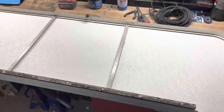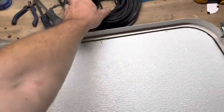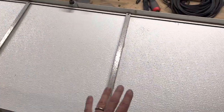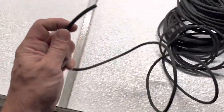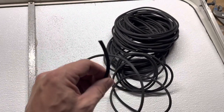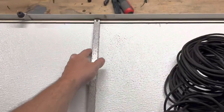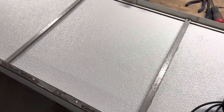Use a cut-off wheel tool to cut along that line — it cuts through like butter. Lay the new shower wall with the smooth side facing outside. Then put two new rivets on this side to tighten everything up, trying to get it centered left to right and up to down. Then take some screen door spline — that stuff you shove in to keep everything tight in window screens — and shove it in all the way around. I also put some adhesive caulking underneath the strut so it actually sticks to the panel.